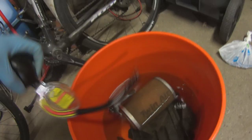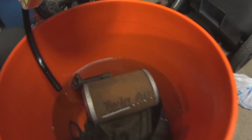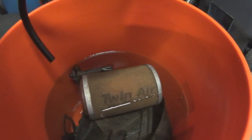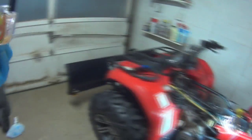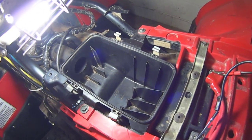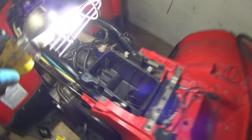I've got some water here and I'm soaking the air filter, because these you actually wash — they're not like a car air filter where you replace them. These are just a sponge and you have to wash them. I'm soaking them, then I'll take them upstairs and wash them with degreaser. I'm soaking all the parts from the air filter box because it gets filthy — it's always dirty in there because it's like a big vacuum cleaner. The filter stops the dirt from going any further. Coolant is good.